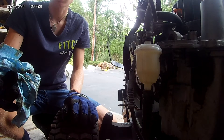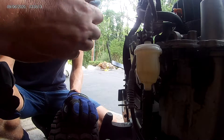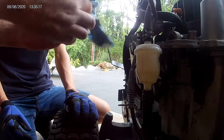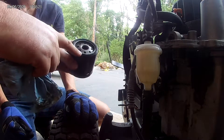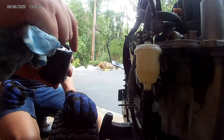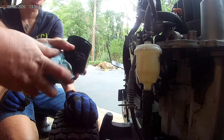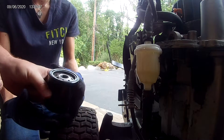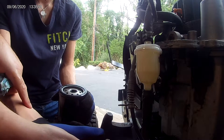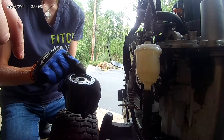With the new oil filter — let's say this is the new oil filter — it's all clean. What you normally do is, you see this little rubber gasket here? Okay. This rubber gasket is what seals the oil from getting outside the engine. So because this would be dry, you would take a little bit of the new oil and coat the seal — coat the O-ring.